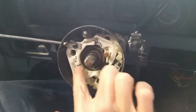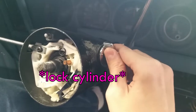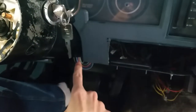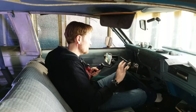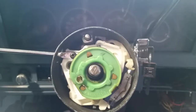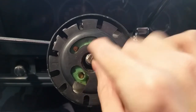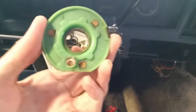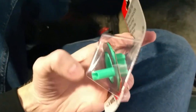Quick recap: this is the turn signal switch — my old one split and it's now replaced. This is the start cylinder, also replaced. And way down there where the wires come out is the actual start switch — so when you turn the key it pushes a rod and does a thing. I changed those three things and felt real accomplished. This spring goes right here, the green thing goes on somehow, then this goes on somehow, and a little metal ring goes in this slot and holds it down — but you have to be able to compress the spring first. This is the turn signal cancel cam, and I got a new one because this one is obviously broken off right there. That's supposed to be sticking out.